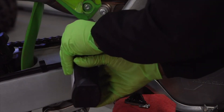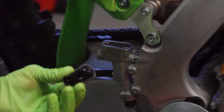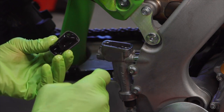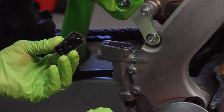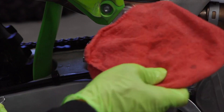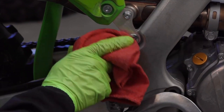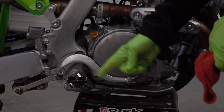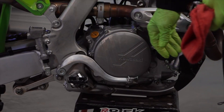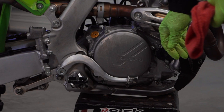After that you're going to want to replenish the master cylinder. Fill the reservoir only about halfway because the rubber bladder is going to displace some fluid. Once you've got it all snugged up, take a rag and wipe off any brake fluid. Now that everything's tightened up, you should have nice pressure at the lever. Pretty simple — probably under a ten minute job.